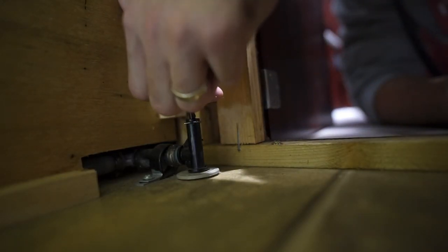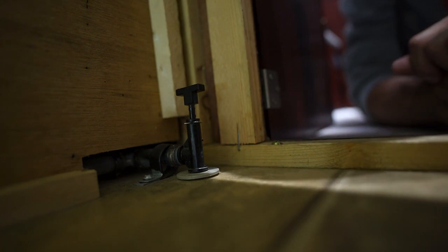For our low-point valves, at least in our Jayco here, we have to step inside our pop-up camper. Those are located in one of the cabinets. One is located right there and the other is way in the back. All you have to do is pull up on them, maybe a quarter of an inch, and they release any water in the lines. Next up, let's ensure that there's no water sitting in either of our drains — either our sink or our shower drain, where you usually attach your gray water tank.